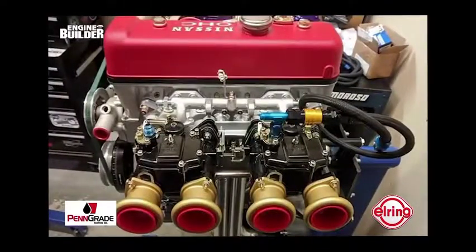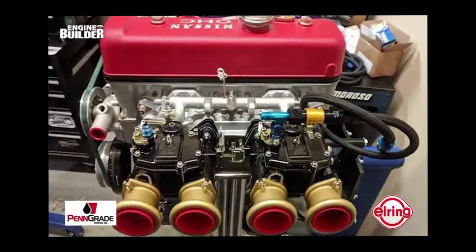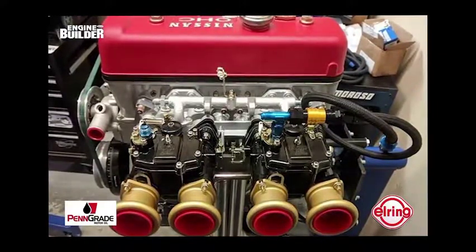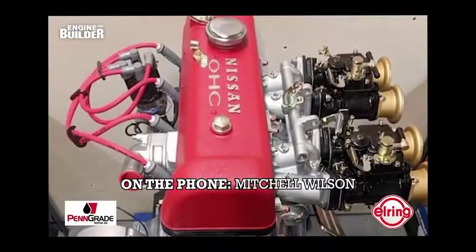The shop did a lot of coating applications to the pistons, bearings, carburetors, camshaft, and rocker arms using Tech Line Coatings. The CP pistons were even diamondized using a new ceramic anodizing process. A lot of the U-20's valvetrain components were able to be retained because they were actually over-engineered for their time. According to Wilson, those parts won't break unless the engine runs out of oil up top. All they did was make sure to cut down as much friction as possible and make it as race-ready as possible.